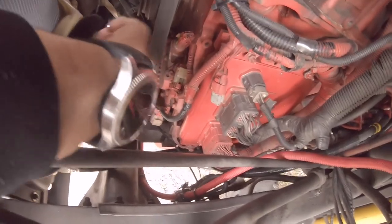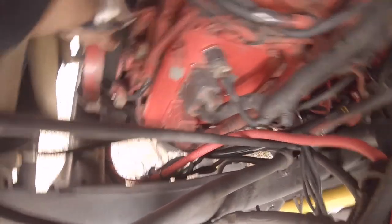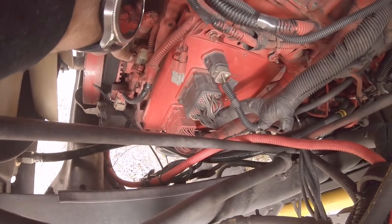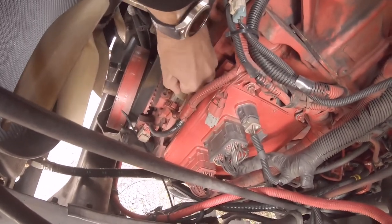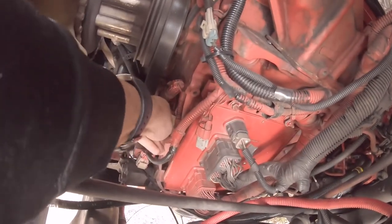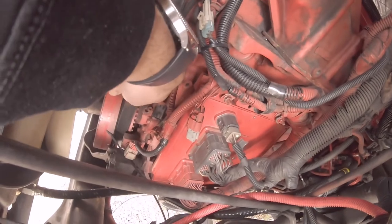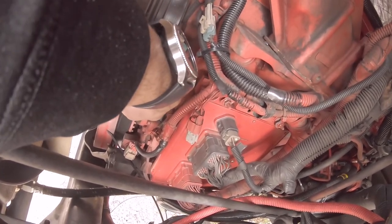Location-wise, we have the cam sensor right there, and then the crank sensor is right below that. You just have to remove those with allen keys — I believe that's the number five. Push in the safety clip and unsnap it and it pops off, then just change those out. Let me get some tools and we'll get that changed out and finished.